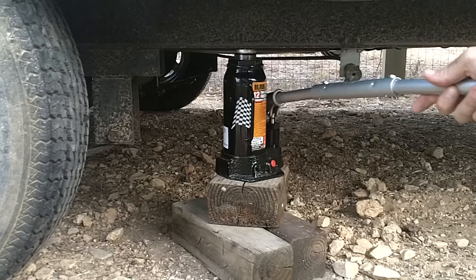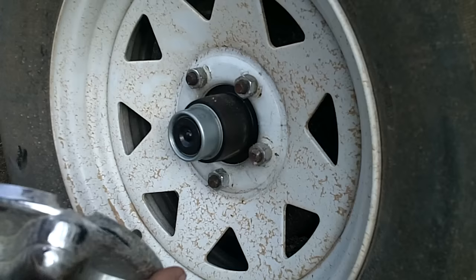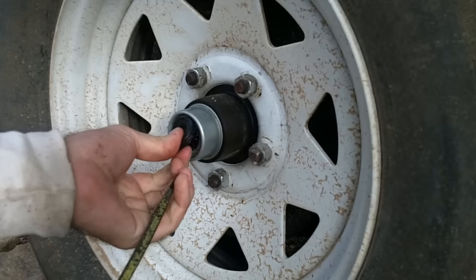Go ahead and lift it up until your wheels spin freely. Remove the hub dust cover — usually there's a little notch that'll allow you to get a screwdriver up under it and pry it loose. Then there'll be a little rubber dust jacket that covers up the grease zerk in the center. Take a flat-tip screwdriver, get underneath it, and pry that loose. That'll expose the grease zerk.